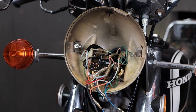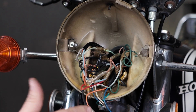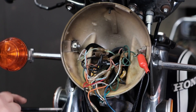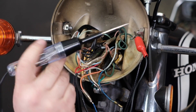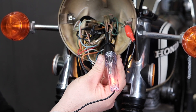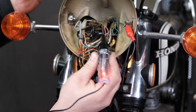We know the headlight circuit is working — high beam, low beam control, indicator bulb, and switch are all good, back to the positive side of the battery. Now we're going to look at the gauge light and taillight control, done with this brown and white wire. In this part of the harness, there are several brown and white wires. The first thing to test is: are we getting power through the brown and white wire to the handlebar switch? I'm going to take my test light, connect the ground, turn on the key. I'll tap into this big bundle where they all merge together — a four-pin connection that's very common. Test light is off with the switch off. Going to low beam — getting power through the switch. Going to high beam — power through the switch at high beam. So from this point all the way through the switch back to the positive side of the battery, we have power.